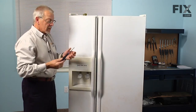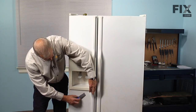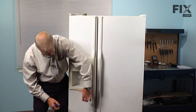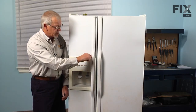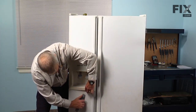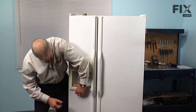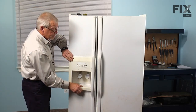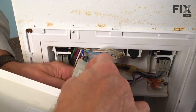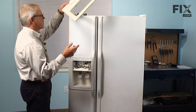Take a putty knife — you should wrap that with some duct tape just to protect the finish. We're going to go in underneath the edge of that escutcheon and at the same time pull down on it and out. It's hooked in a couple of spots on the bottom and there are three tabs across the top, so it needs to come off at the bottom first. Then just lift up on it and tilt it out. Next we'll disconnect the five-pin plug that feeds the switches and set that aside.